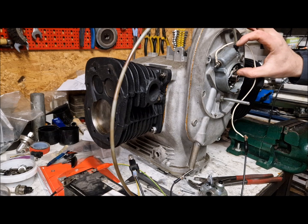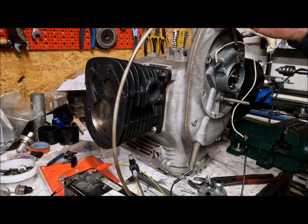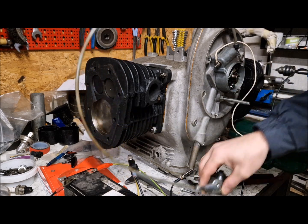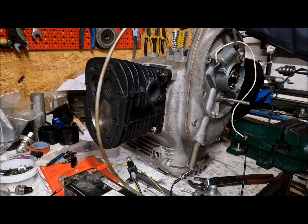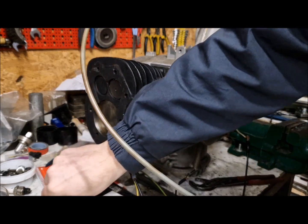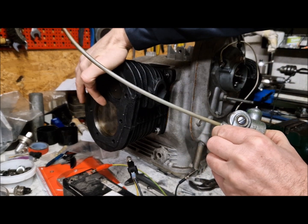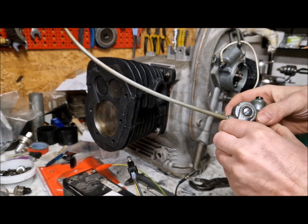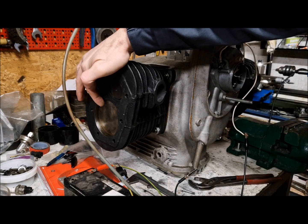You can do it also manually, but this way you can make the setup here on the bench. You will assemble the engine on the bike and when you connect all these parts you will have a functional system, already with the setup made. It is much easier to make here on the bench than on the motorcycle. With the ignition retarded, we need 8 degrees or 2 mm before top dead center, and with maximum advance we need 35 degrees or 8-9 mm.